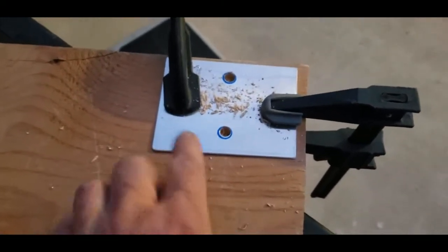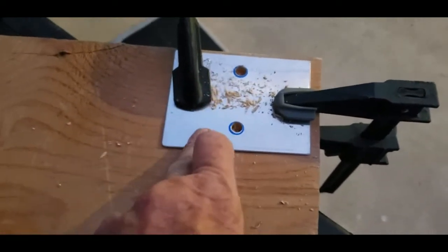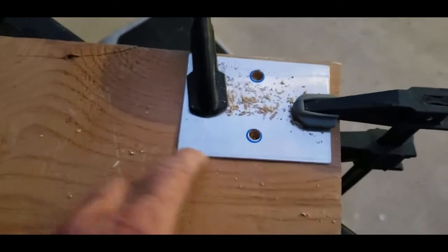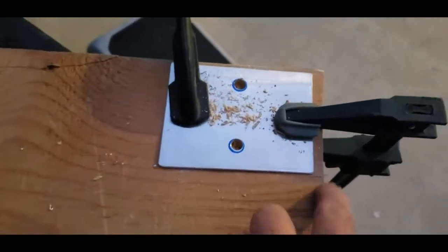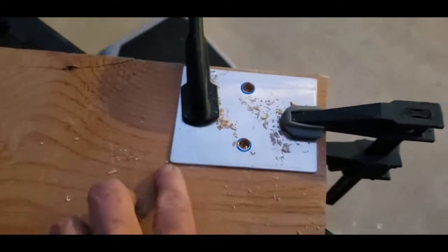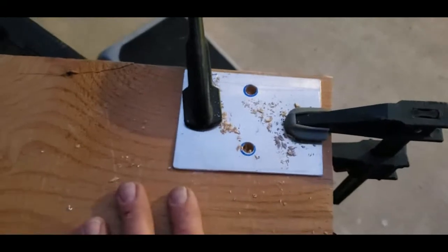And also, when I said it's going to be the clamp, and then the metal thing, and then the shell, there will be butyl tape underneath this entire support washer here. So don't forget the butyl tape. And then when it's all said and done, we're going to squeeze in some of that Dicor. But this is just the prep work.